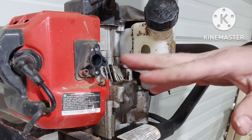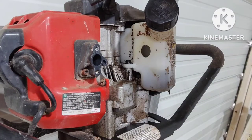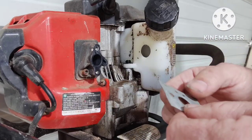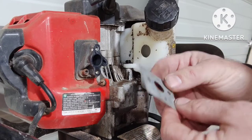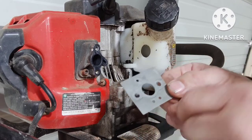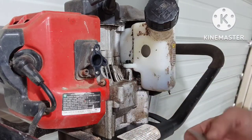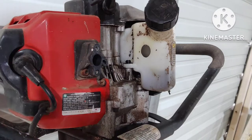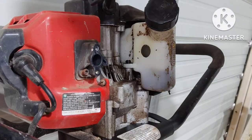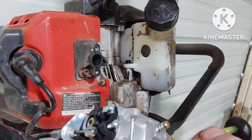Alright, so we can mount it back on. Let me get the rest of the stuff off the other carburetor for this side of it. This kit does not come with an intake manifold gasket. The square gasket that I pulled off the other one — I got it off with no problems. You can use it upside down, so I'm just going to put it on a different way so that it has a new sealing surface. It's all symmetrical — you can put it on any different way and it'll work. The kit didn't come with one, and I'm not sure how I would order one for a Thunder Bay. So I'm going to get the fuel line and everything back in. I'm going to do the same thing with the silicone spray on the seal here, and then slide everything back in.